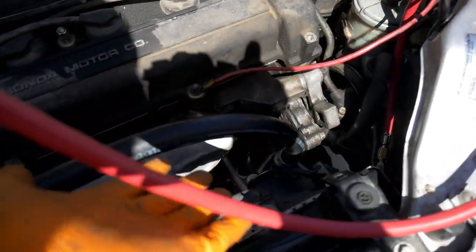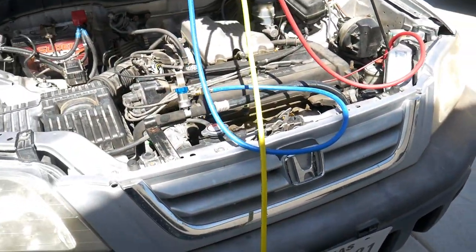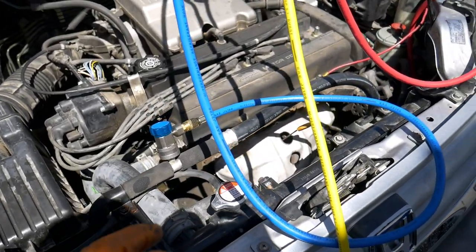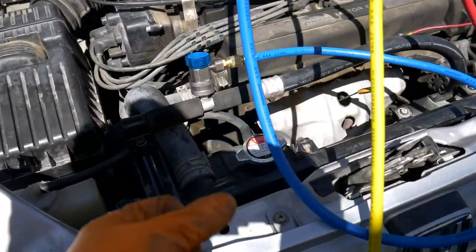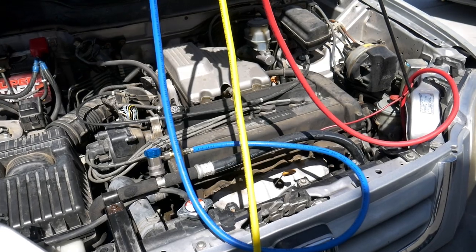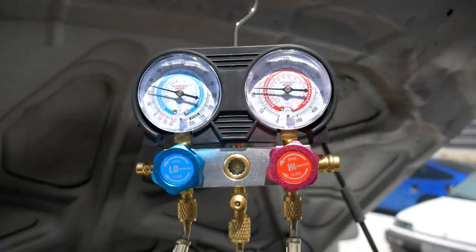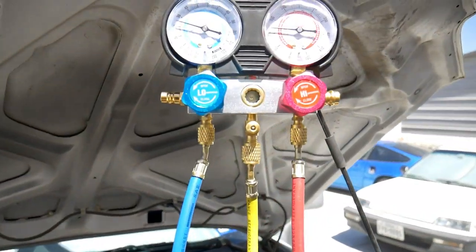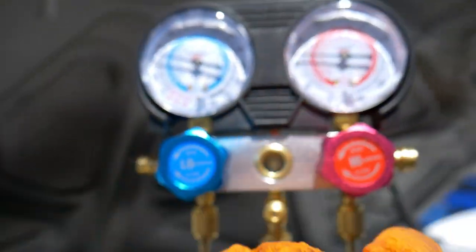My compressor obviously broke on me and I was able to change the receiver dryer, condenser, and some of the O-rings. Hope this helped you guys out today. I will update the description if I have any updates, and if anything changes and I need to replace other parts. I'll try to update it as summer comes to a close and let you know if it's still working and if I've had to add any additional R134A. I don't want to overdo the pressures — if you start putting in too much you risk damaging the system — and where it's sitting right now, it looks like it's okay.